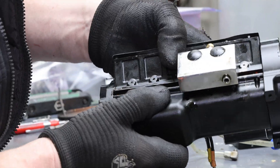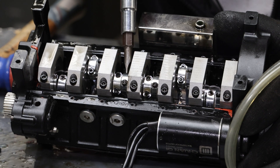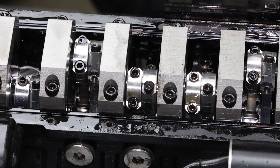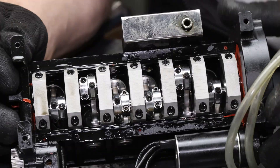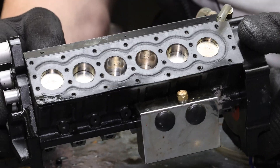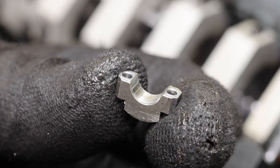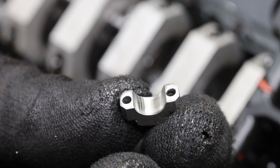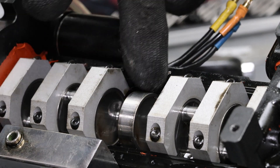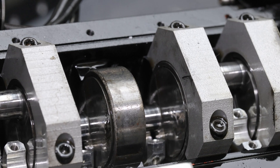Looks like there are six journals and 12 cylinders, so they joined up two connecting rods per journal. There's quite a bit of slop there — it might be that little chain sound I was hearing. I think it's just going to be a compression issue. I'll pull these pistons out and take a look — I bet they just have inferior ring design. The cap is just machined right onto the crankshaft with no bearings. It looks very steam-engine-like — they just took one solid bar and machined it. There's a little sleeve bearing in the flywheel, but the journals don't have any bearings.